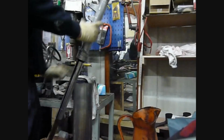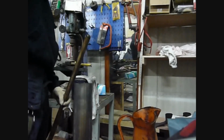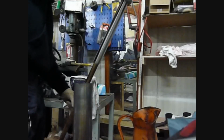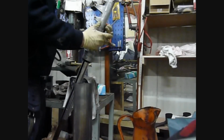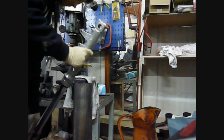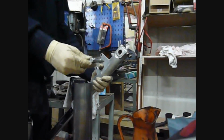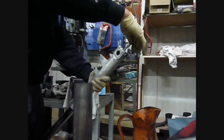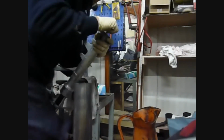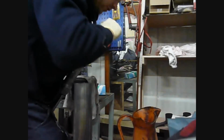So next step is get a standard broomstick. Upside down, the fork goes on there, and that's to hold all the bits in place. What you're going to do is with your Allen key. The Allen key is going to go into the top here, and then you're going to just apply pressure down on top of the fork and just undo the bits here.